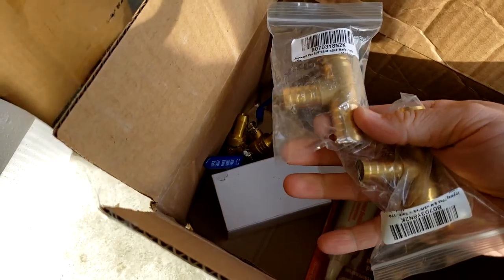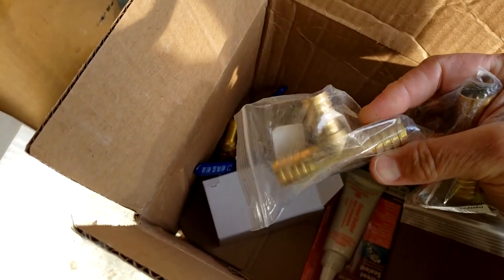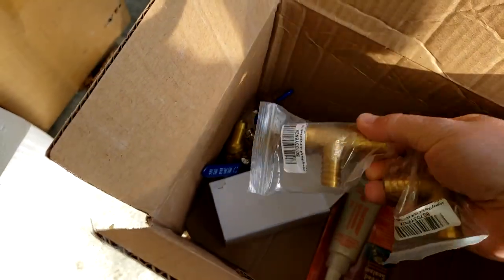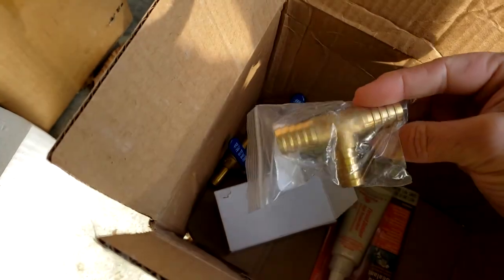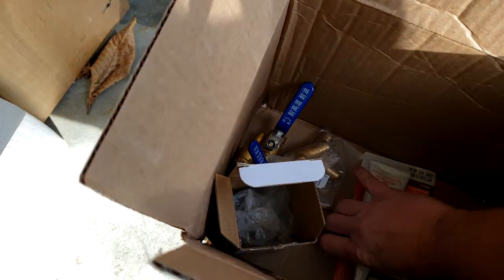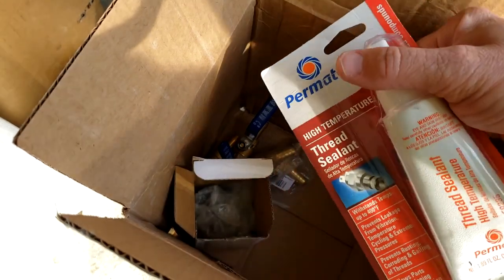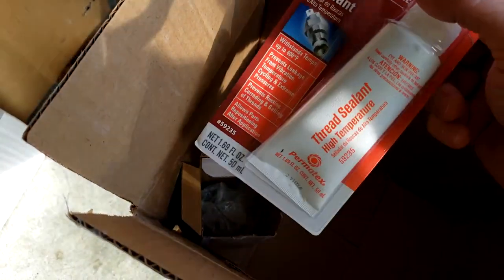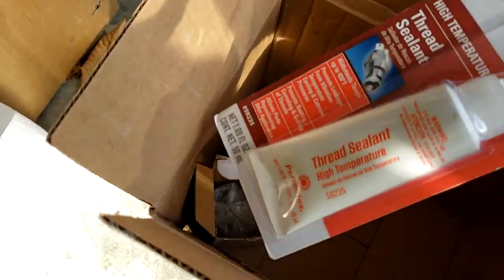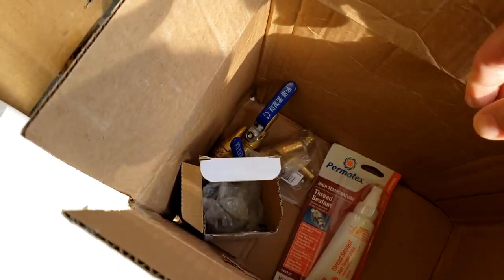And this is how we're gonna tee into the factory hoses. It's an adapter from 3/4 inch to 5/8 inch heater hose. And I'll have links for all this stuff in the description. Then I have some high temperature thread sealant. It's kind of what we're gonna use to plumb the lines. It doesn't really have to be a high temperature, but it'll withstand up to 400 degrees a little bit better.